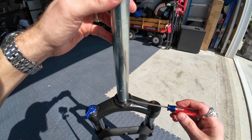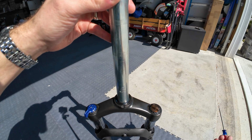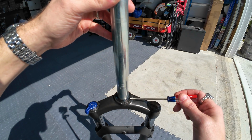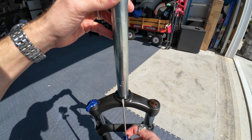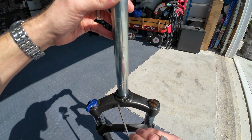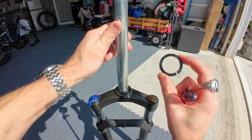If you can see right here, this one that's on the Aventon, it's got this little gap in it right there, which is gonna allow this to pop right off so easy. Normally I gotta shove razor blades under here and slowly pry it up and get a screwdriver under there and pry it up. But this one, put the screwdriver right here, boom, look at that, came right up. Wow, so easy. Normally this is like a 15-minute process to get this off, and I just did that in like 3 seconds. Wow, lucky.